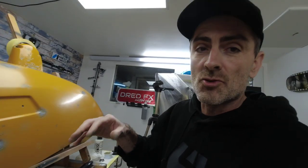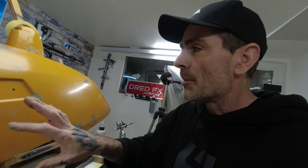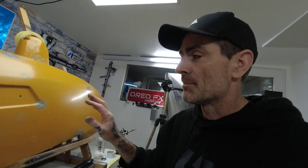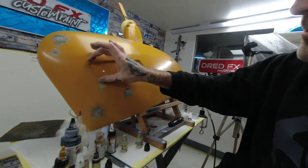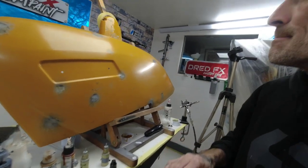The next stage on this is to drop the stripes in. I'm going to let this paint go off for a minute because I've built the layers up in water base, and let this cure right down. And then we can drop these stripes in that go back in here and then get some clear coat ready. So I'll see you in the next step.